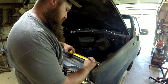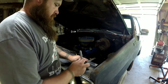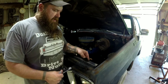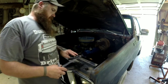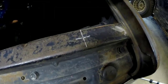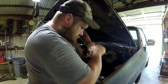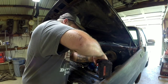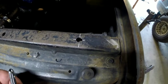So I'm going to measure four and a half inches. Now I'm going to make a centerline on this rib here, which is about one and five-eighths inches, so about 13/16ths. I'll make the mark there and go ahead and put a center punch in. So what we've got so far is just our crosshairs with our center punch. I'm going to use my handy dandy step bit. I've got a half-inch hole drilled.